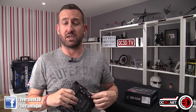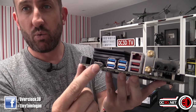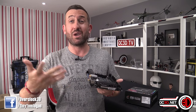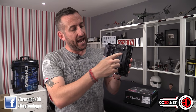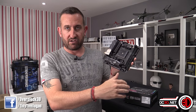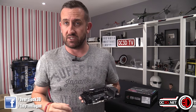Normally with a B450 chipset they're aimed at people running one of the APUs, like the 2200G or the 2400G. All of the boards will come with onboard video, but that onboard video will only work if it's an APU, because the graphics are on the CPU itself. There's no real way to crossfire anymore, so you choose one or the other. If you want a dedicated graphics card you can still get a Ryzen 3 quad core without the APU - you just connect your HDMI or DisplayPort to the graphics card itself.